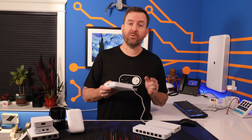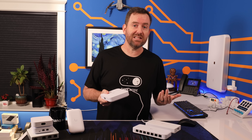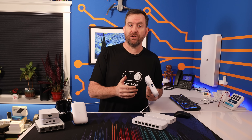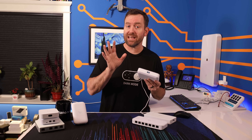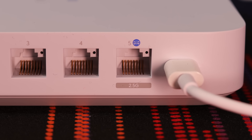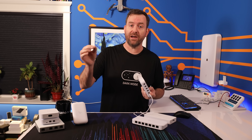I'm not sure if they've given an official reason for this, but the way I look at it is that the 2.5 gigabit WAN port is to ensure there's absolutely no bottlenecks for your internet connection up to full one gigabit. If you have a full one gigabit internet connection from your ISP and you plug that connection into a one gigabit ethernet port, you're going to lose a little bit of that bandwidth due to ethernet overhead. You don't really ever see maximum throughput on any ethernet port — you can get close, but you're never going to hit 100% capacity. So by making the WAN port 2.5 gigabit, they're adding in additional capacity so that you can take full advantage of internet connections up to one gigabit.